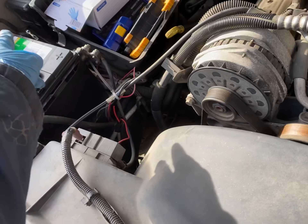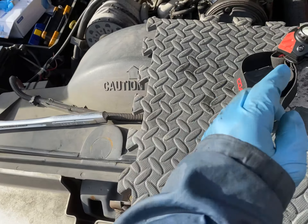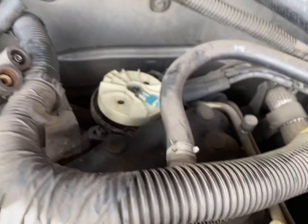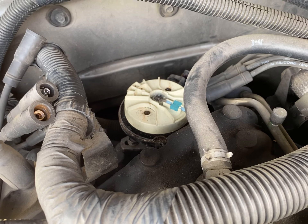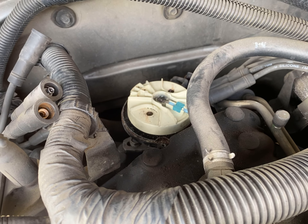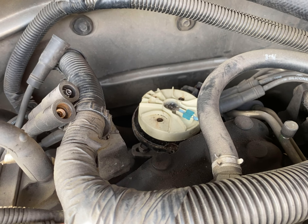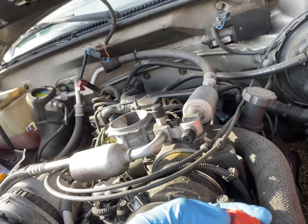We got the starter in to turn it. Now I'm going to take out the starter power. And then we're going to take out the distributor — try to take out those two rusted bolts on the distributor cap rotor — and then drop this thing back in. And then do the correct timing using the cam sensor with the scanner. And hopefully the thing will run right.